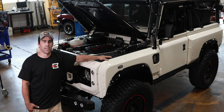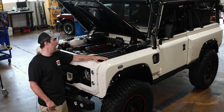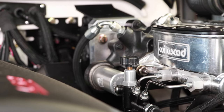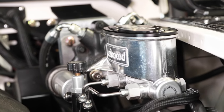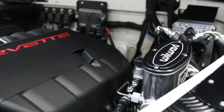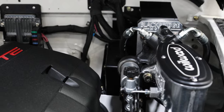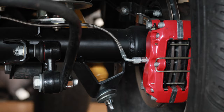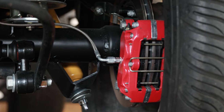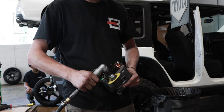One of the things we created, designed, and installed here at Blackbridge Customs is the hydro boost braking system. Having hydro boost in a vehicle like this is really needed with the horsepower produced from the LS. It gives the customer a sense of safety and security, because that brake pedal is always right there and ready. We also install big brake kits in many of our builds — a four-wheel disc brake system that really complements the hydro boost braking.